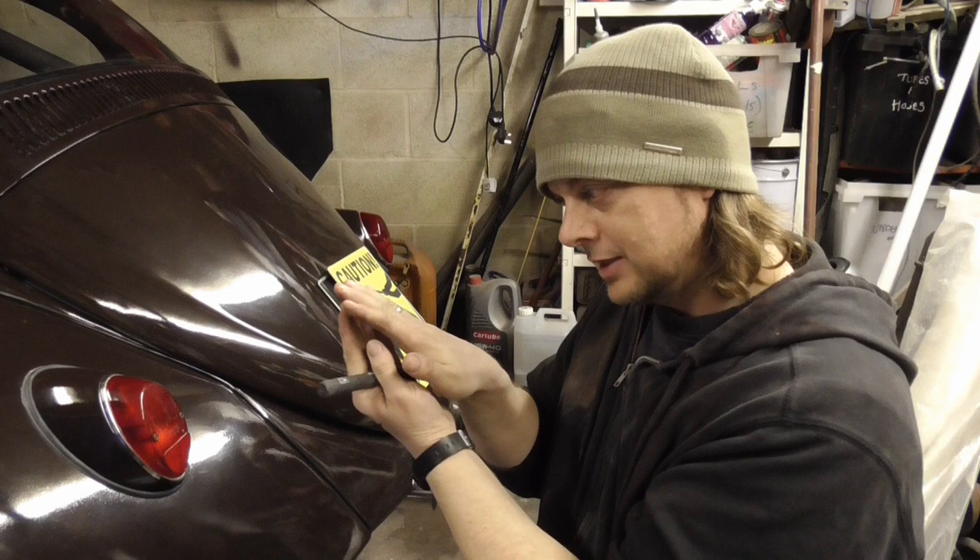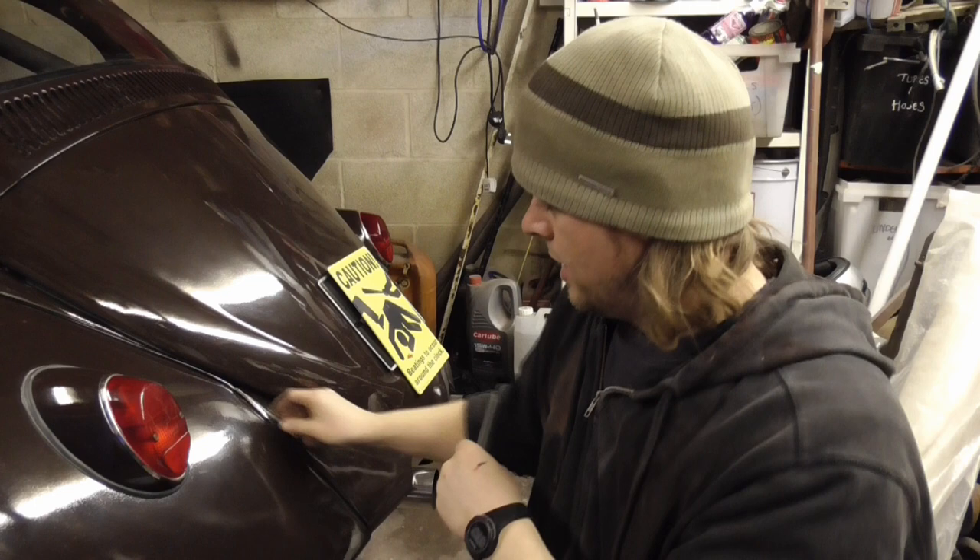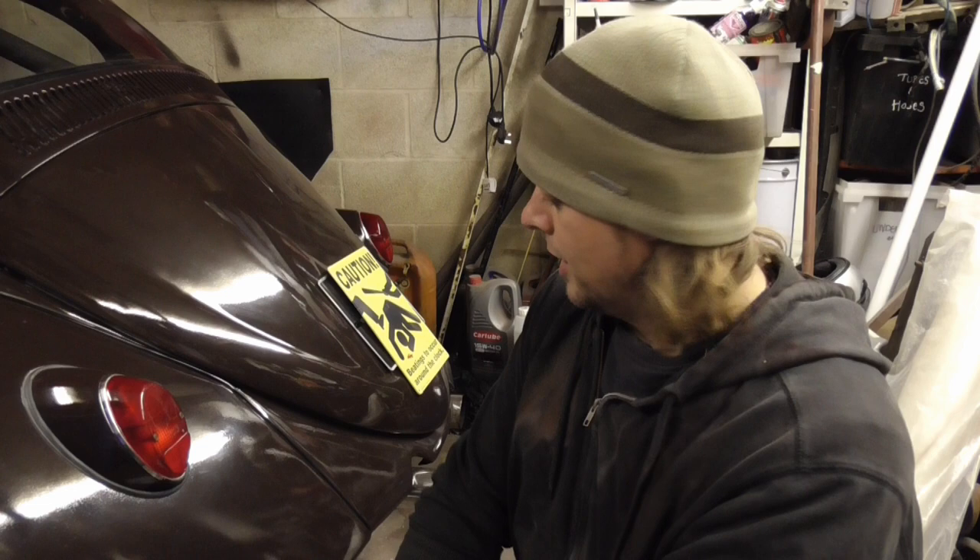When I did mine the valance actually sat a little bit high, but when I had the wing beading on you couldn't really tell. The trickiest part is just getting it all lined up and marked out in the first place. Just tack it, test it, see if it looks right and then do a final welding job. Well worth doing.